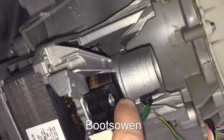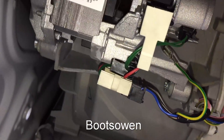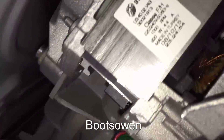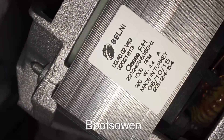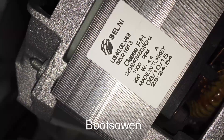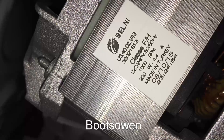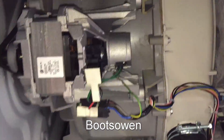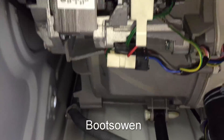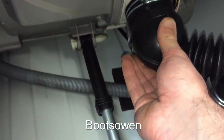In underneath is a motor, and I can see that it's got a commutator ring and carbon brushes, so it's a brushed universal motor, which means it's easy to hotwire — and I've posted a video about that which will explain everything in much better detail. There are some codes on it — 1000 RPM? Seems a bit low. It should go about 15 times faster than that. Everything is quite clean, but I guess it's a five-year-old machine.